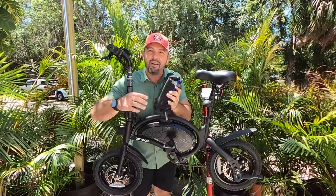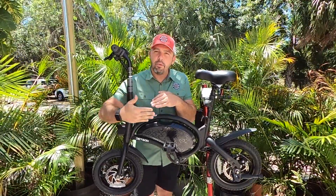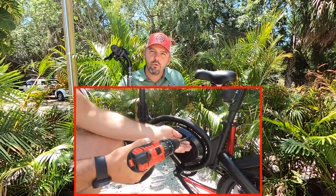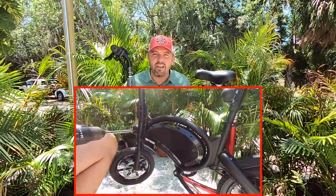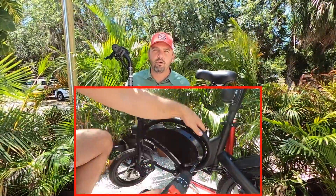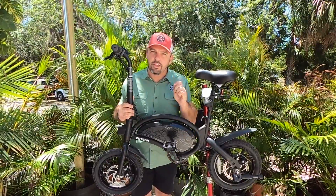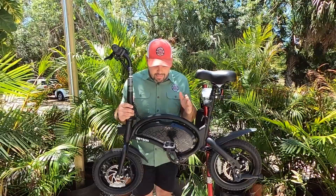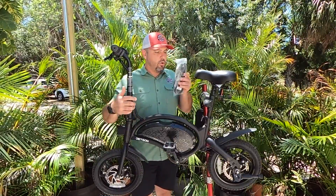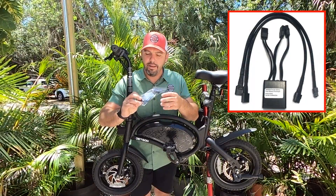This is where I've actually put it on my personal electric e-bike. We anticipate a pretty quick install. The bigger burden with this casing is going to be the rubber plugs that fill the screw holes around the casing — I believe there are seven screws we're going to have to take out, so we're going to be careful not to strip those. We're not going to break the case, and when we put it back we have to be ultra careful not to over-tighten. We anticipate an XT60 setup, which is going to go quite well with our Electric All Wheel dual battery discharge balance kit.